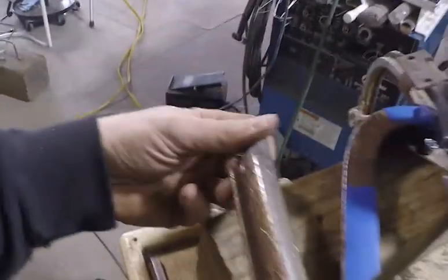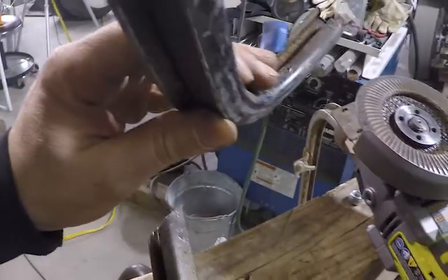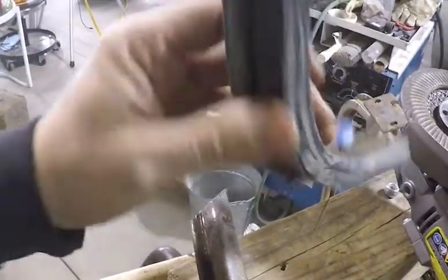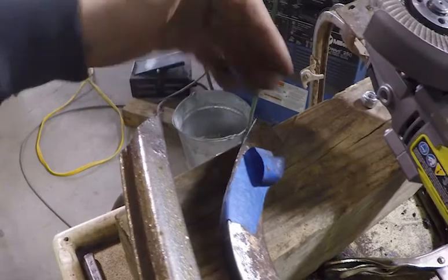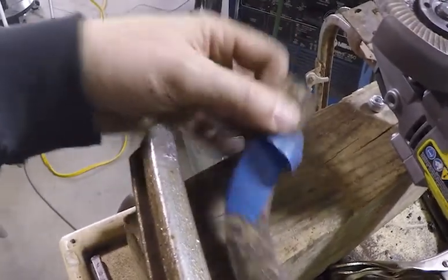And then I'm going to clean up all the ends, take all the burrs off them, deburr them, file the inside of all the holes, make sure they're clean. Where this welds the top piece, I'll bevel this in the edge of the top piece as well, where I weld them together, so it'll be nice, fill that with weld.